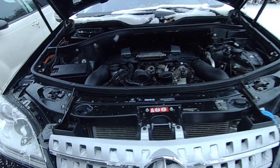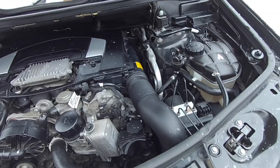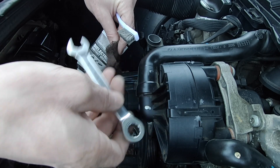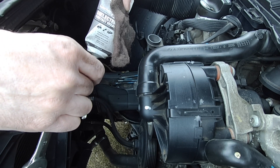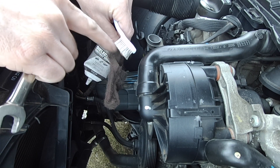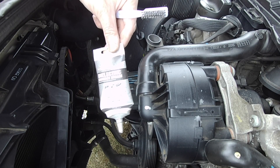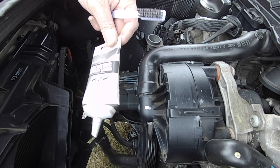Yes, it is snowing out — it wasn't supposed to snow today, but unfortunately it is. I have my electric vest on and everything, so I'm nice and warm. Basically what you're going to need to do this job: most of the grounds look like they're 13mm. I normally like scotch pads for cleaning up electrical connections, but I don't like the mess they make. So I'm actually going to try this little stainless wire brush today. For dielectric grease, you can choose any brand you desire — I like this Lubromatic stuff. It seems to work really good.